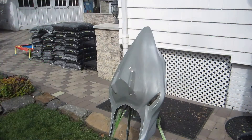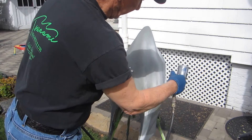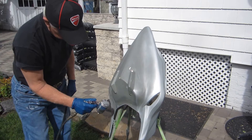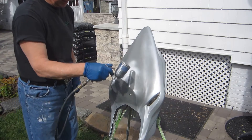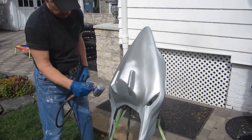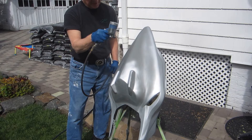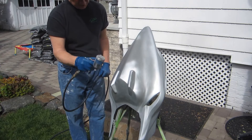All the inner edges have a coat of silver now. Keep in mind: silver is the worst color ever to paint. It shows every single mistake. In the world of model planes, we paint things silver to find a mistake — it's like fluorescent lights. I suspect that when I'm done a part looks pretty nice in primer, but the reality is when this is done with silver we're going to show a lot more mistakes. I'm just dusting on this first coat — I know it's going to need three coats. The Benelli silver, if you haven't seen it in real life, it's a beautiful color when you get the third coat on and all the flakes are sitting nice and straight.